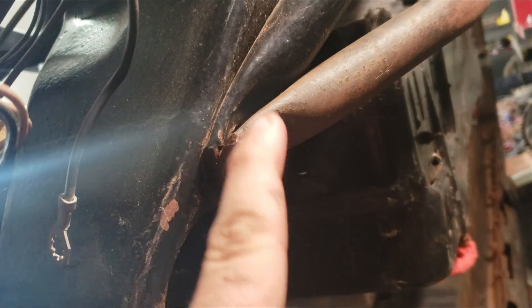Next we're going to talk about the braces that go from side to side on your core support. The front core support brace will only work for guys that aren't doing boost — like I have a car with an intercooler and it won't work. It's really for guys that just want the brace and aren't going boosted, unless you want to do some modifications. For big block guys, stock-style LS guys, small block Chevy guys, it just tightens up the core support.